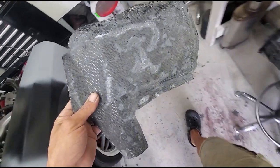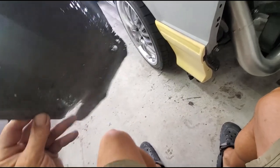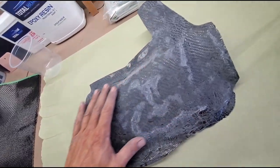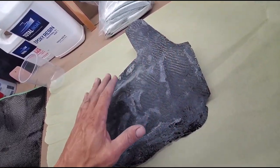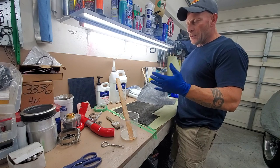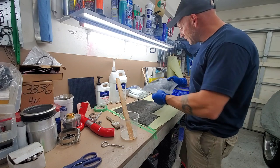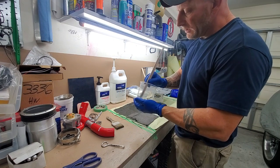After sanding the back side — see it's looking pretty rough, but it's actually in good shape. Sometimes you get it in one shot just like body work, other times it takes two or three times to get the fitment absolutely perfect. I'm loving it. We'll give it a little more structure — this is going to be a laminating style now. I'm going to brush some epoxy on, stick the carbon on it, work it into all the corners, hit the top with epoxy, let it dry, and trim it. With epoxy you've got to sand it to build up another layer — unlike fiberglass or polyester laminating resin which doesn't need sanding between layers.